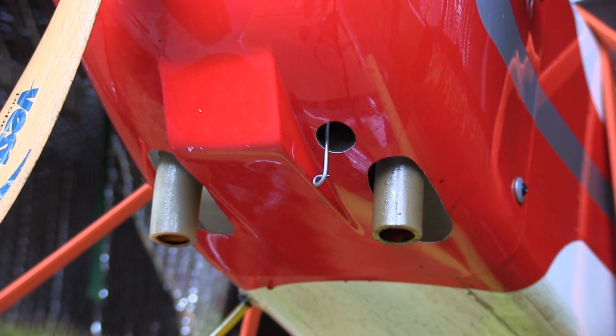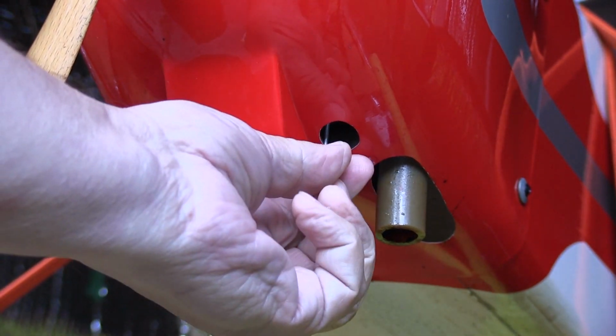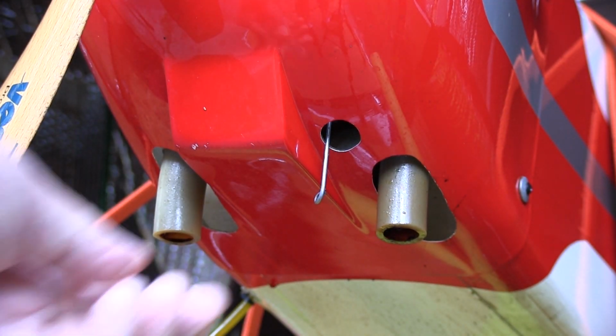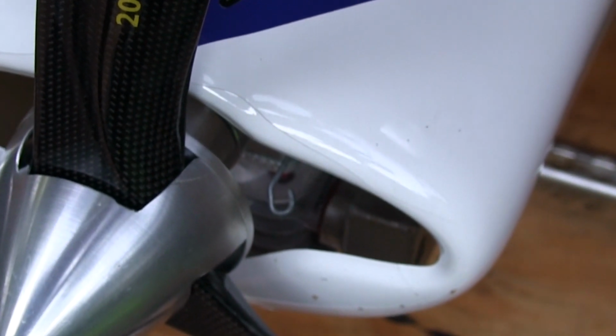You'll find that many of the multi-cylinder engines have the carburetor hanging straight down underneath them. That means the simplest choke rod just goes straight up and down. When the choke rod isn't suspended at any point along the way, I'll use a ball link or something where it attaches to the choke arm. And that's all I've got on manual choke rods.